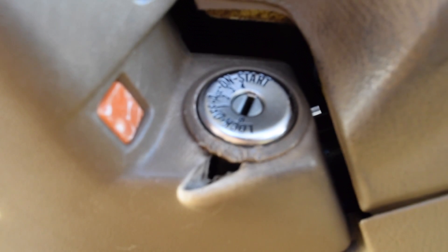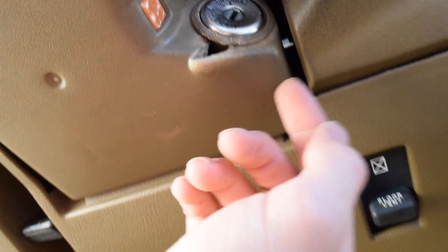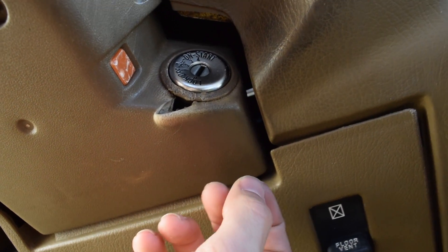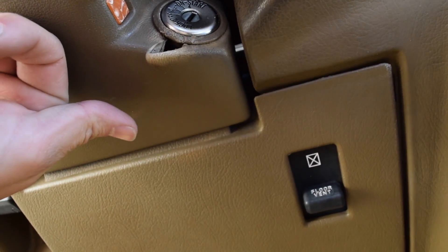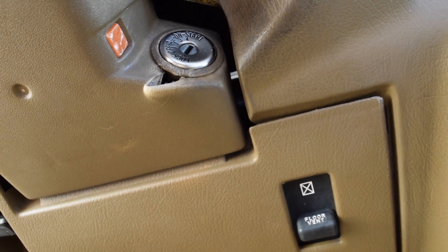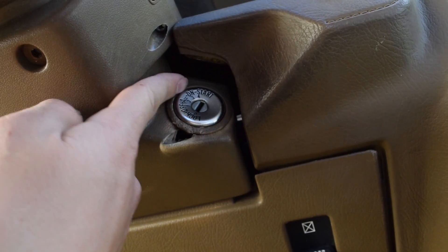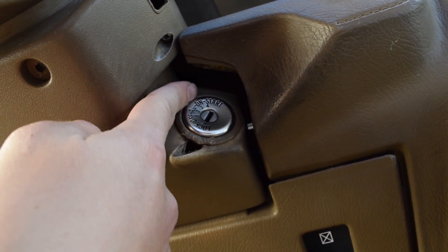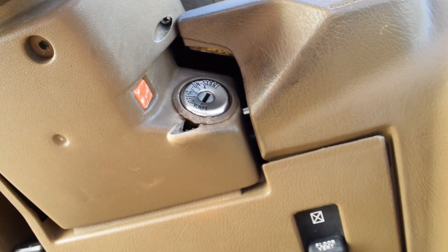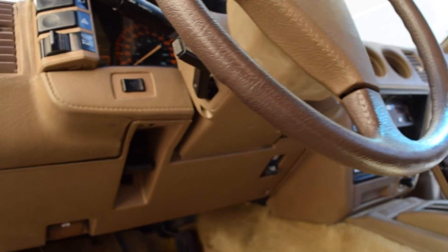Right here is our key cylinder. The ignition cylinder has four wires that come out of it. I've got a picture of which one I chose, but let me show you so you can double check for yourself before you go ahead and splice it. You stick a positive voltmeter into it and then stick the negative voltmeter onto a piece of metal just to ground. And you turn the key, and once it gets to the on position, you want to see 12 volts through that line. You don't want to see 12 volts through lock, off, ACC, or anything else — just the on position. So when you turn your key on, it'll go ahead and turn your pump on. This is only if you burn out your ECU; if you do this before you upgrade your fuel pump, then you'll be all fine and can just use the standard one.